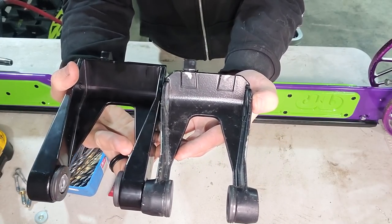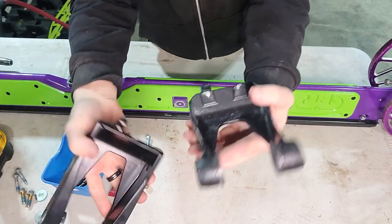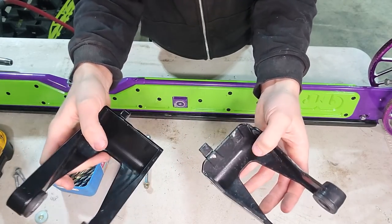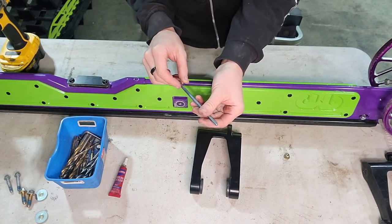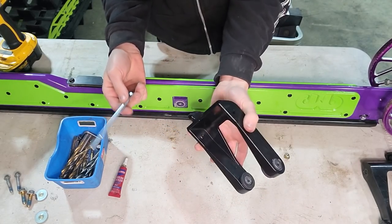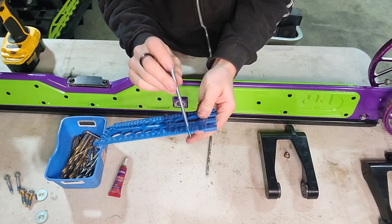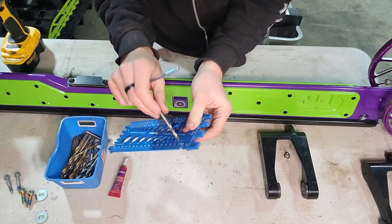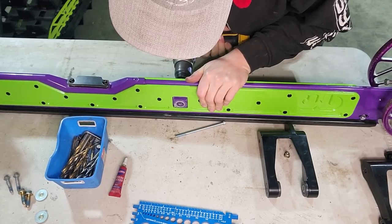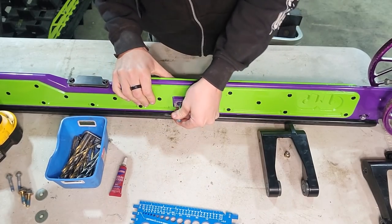Side by side you can see that even the sidewalling is substantially thicker — they've done a lot of work in this area to make that brace quite a bit bigger. It is a little bit heavier, not a whole lot; I didn't take the time to weigh it. To install this we've got a drill. This screw is actually news to me — I didn't know it came with this kit. I didn't know originally that we were doing a through bolt, so that's awesome. We're going to be using a number six drill bit and sending it right through the rail. Beautiful — snug fit, perfect.